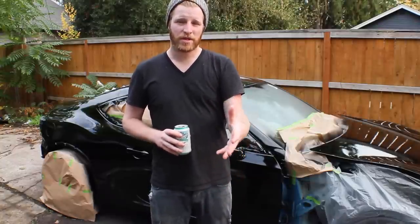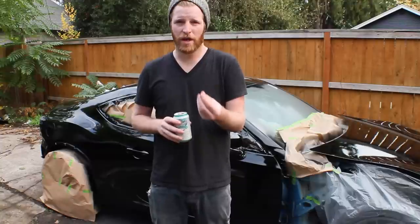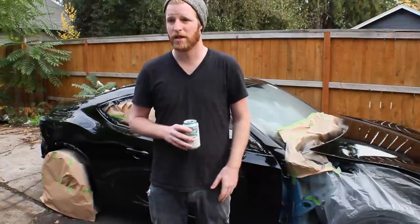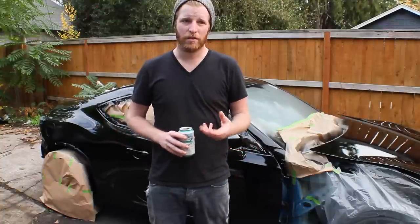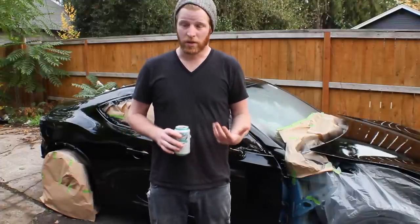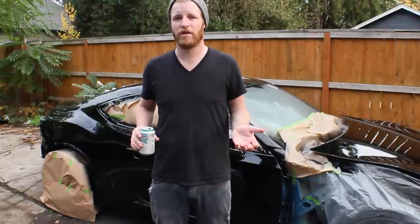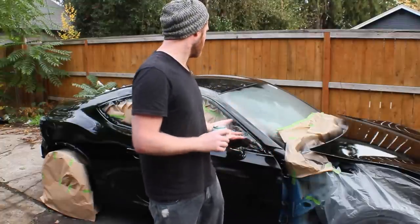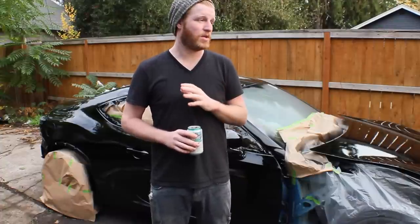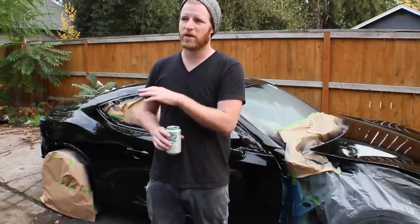The biggest thing I spent was $150 on my air compressor and it just wasn't good enough. If I would have rented one I would have got a much better paint job. Basically the higher air pressure you can have, it atomizes the paint a little bit better and sprays it on much finer, so you use less paint and it has less orange peel. The outcome of this paint job is pretty good — the orange peel is a lot less bad. It's still there, but every paint actually has orange peel and this has a decent amount but it got a lot better. It was a long, really hard day's worth of work. I only ended up having to spend about $50 for some new paint and $50 for another gun, so in the end I think I spent about $600. I'm not going to be painting the Camaro the color I want — down at the paint store they told me that was one of the hardest colors to paint. So I've decided I'm not going to be painting the Camaro, which is kind of a relief, but I do have all this painting stuff so I can use it on any other project.